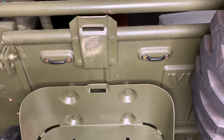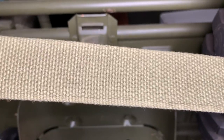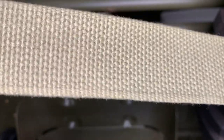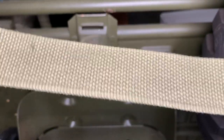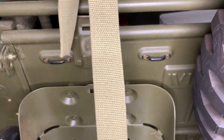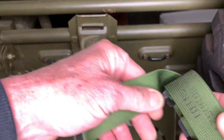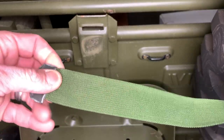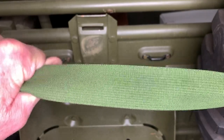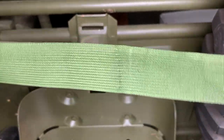You can see where my old straps wore the paint right off the bracket holder — that made me a little mad, but we can touch that up someday. I also want to show you something about these straps. They're made with cotton or a cotton blend, and if you pull on them they stretch just a little. Over about 30 inches you'll get some good stretch, so if you're a little short it will stretch out over time, similar to OD canvas tops that get tighter and looser with heat and cold. The old strap I had on there is nylon — you pull on that and there's no stretch at all.